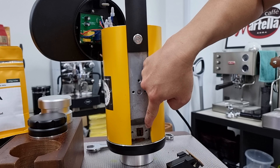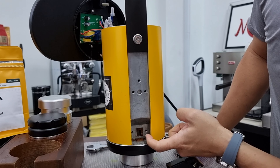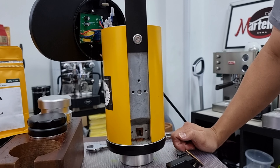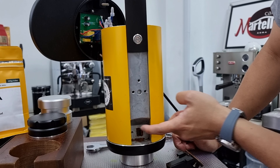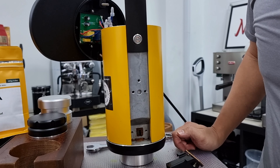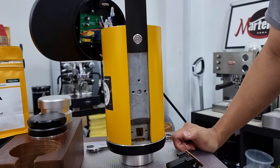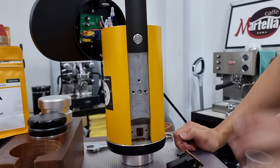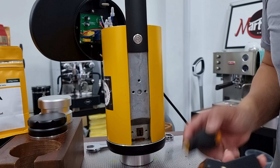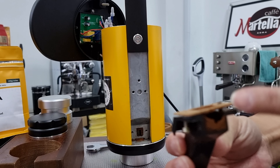As you can see, there's still a little bit of coffee that's actually stuck behind — I didn't really blow my grinder well. But this build-up of coffee ground around the exit is actually an inherent problem. Whether you have a declumper installed or not, there will be some coffee ground that builds up at the back. I've been using this grinder for about seven days, quite often every day, and you can see this is the amount of build-up. If you do not want the coffee ground to build up, you should take out the declumper and do some maintenance weekly. There's also some coffee built up here.